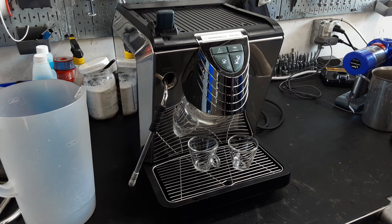A lot of solenoid valves in there, which is again good for a machine. However, if you don't descale it, it would be detrimental. And so you might see a little bit of issues arising in sometimes clicking a button, and it has a little bit hard time pushing water. That's usually because solenoid valves, you can actually hear the solenoid valve when we start to brew kick on and release all the water, but sometimes it might not release all the water because there's just so much scale in the machine, which is why we're wanting to do a complete tune-up on the machine.